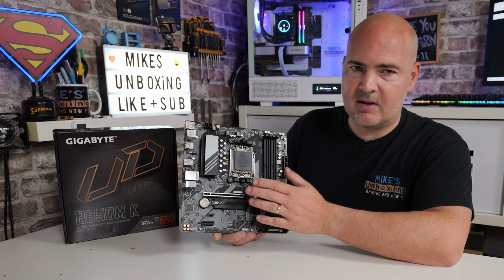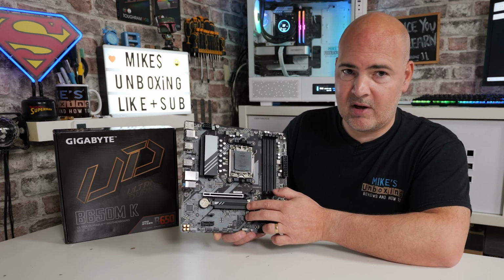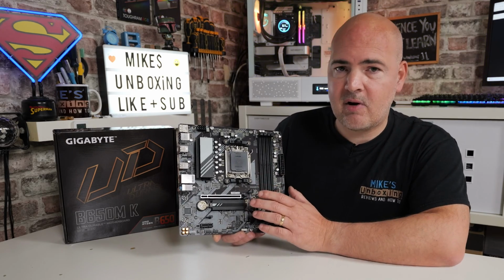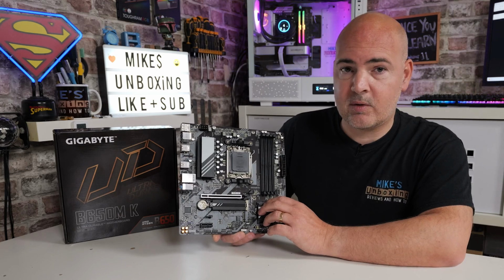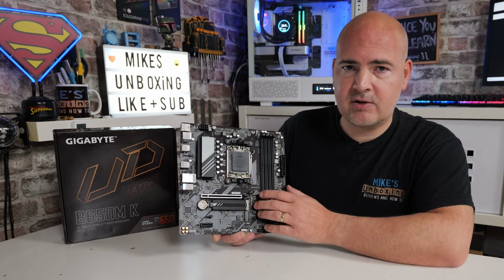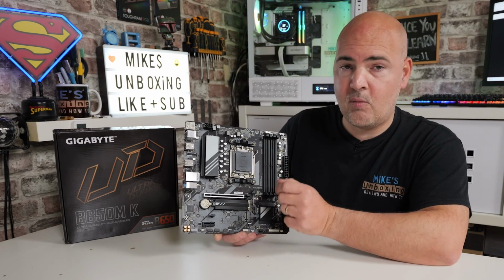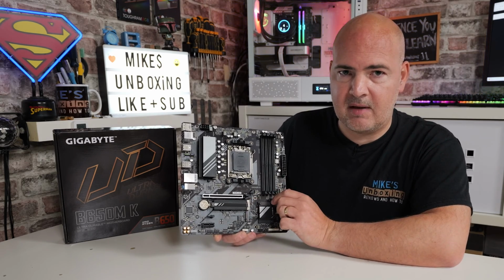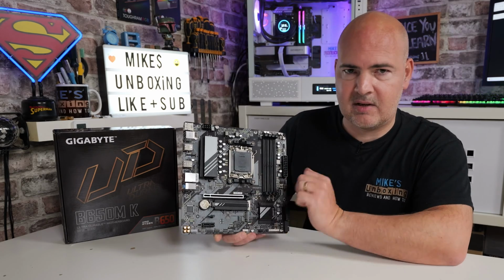So if you buy a graphics card that uses x16 and two PCI Express Gen 4 x4 drives, you are going to be sharing bandwidth. Now of course, looking at how graphics cards are going, a lot of graphics cards now are using PCI Express Gen 4 x8 slots. So in which case you can go into the BIOS using bifurcation. You can allocate x8 to the graphics card slot, giving you the full PCI Express Gen 4 x4 to both of those additional slots underneath. Obviously, your graphics card is going to be the factor there which defines which of those setups you can use.